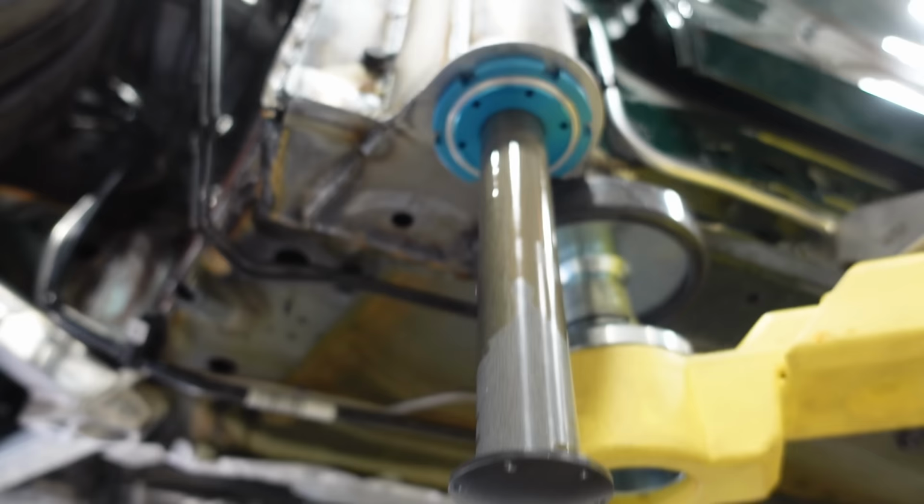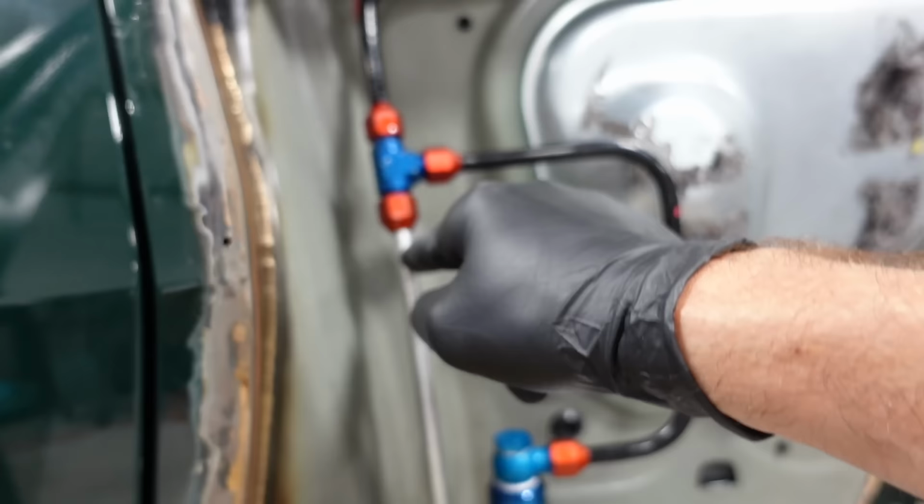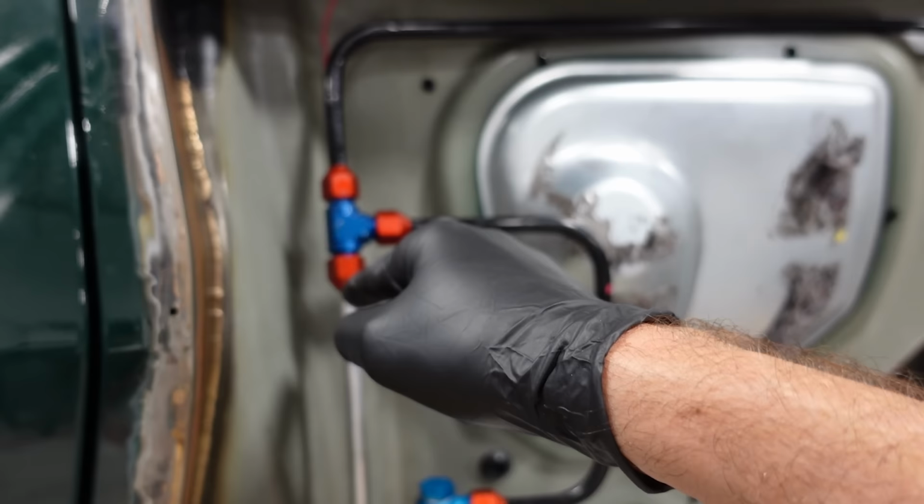Oh my gosh, that's so dope. I was wondering, these things have to be oiled, and they are. So unfortunately, this and this aren't making the seal that we need. This is the extra line that we bought, and on both sides, it's leaking on this identical spot. So we'll have to do a different ferrule, which is the brass fitting that is pretty much a sandwich plate that crushes it.